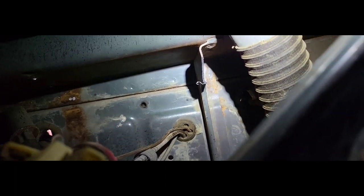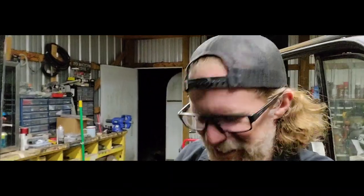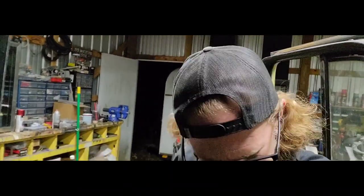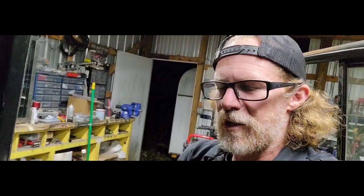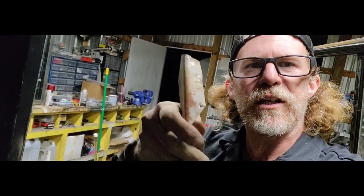All that is left is, I'm going to show you, so you can see just that piece up on top, and it drops down to where the 1/2-inch bolt was, and all the rest of everything was cut out of the way to give us access. There's a spot weld right there, that's the only one, and then there's 3 that run across the top there, and if you can see, they're a little difficult to get to. That's why I'm hoping, and hopefully this works out for you as well, because it only has the 1 spot weld here and the 3 here.